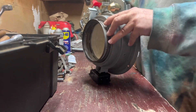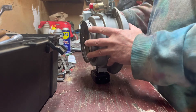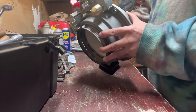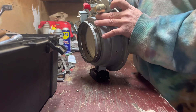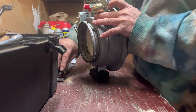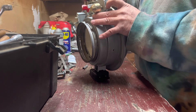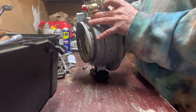There's another big step to this thing which I have a feeling a lot of people are missing. This piece here has the same little tab sticking out that the wick is gonna stick to. According to the manufacturer and all the videos I watched, what you want to do before you attach that is raise the wick up all the way. This has a safety function — basically when you tip this heater over or jar it too hard, it's gonna snap the wick right down to shut the heater off.